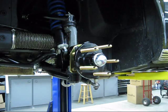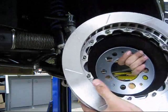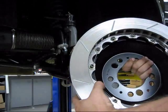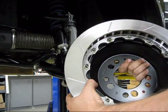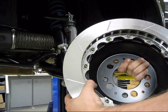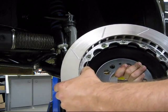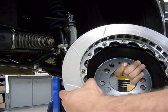Next piece is to install the rotor. It's a very nice piece that comes fully safety-wired with all the bolts installed. These are very heavy-duty rotors — all USA-made castings, no offshore rotors. When the time comes to replace the rotor ring, I recommend buying the rotor rings and replacing the bolts as well, since the bolts see quite a lot of heat cycles and it's just good insurance.